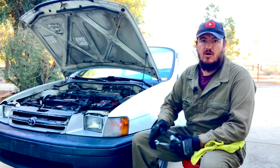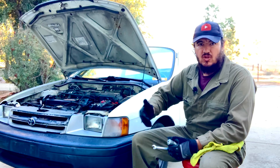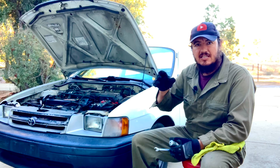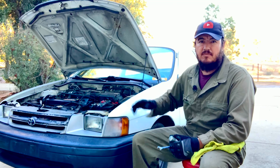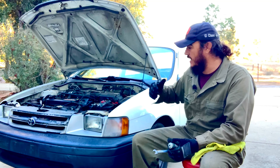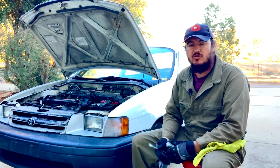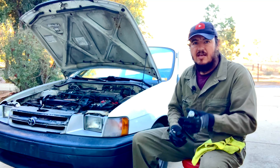This was a simple maintenance you can do to your battery and connections. Sometimes you have a car that feels really heavy starting, but it's not the battery — it could be the connections not sending the right amps to the starter or the electrical system. You might replace the battery, but if you have dirty connections at the terminals it can still cause problems. So why not do this preventive maintenance and save a battery just by cleaning the terminals?